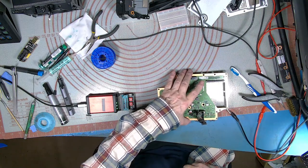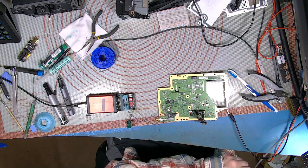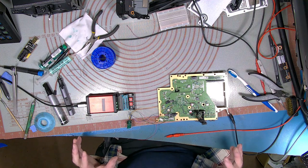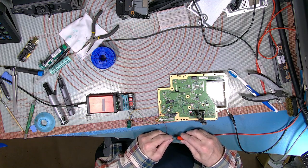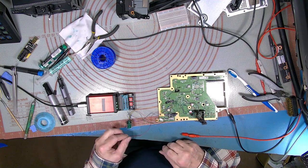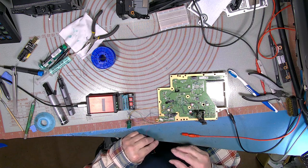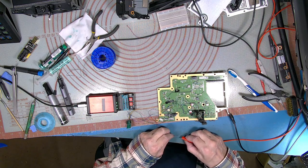I'd say it's quite a faff to do, it really is, but it is so much faster to swap the EEPROM, which, as I say, most people will do. But because these are my working machines, I'd rather swap the data. You needn't worry about having to do all this unless you really want to. I mean, it's fun. All you need to do is swap the one chip, but it is a tiny, tiny chip. And like I said, if you have an accident with it and you haven't got the data that's in it, you've lost your machine. So you need to be extremely confident that you can take the chips off and put them back without any problems. Otherwise, you could end up losing the machine.